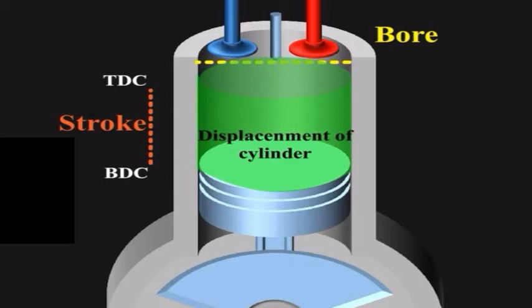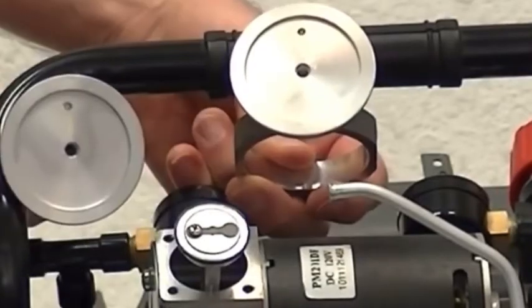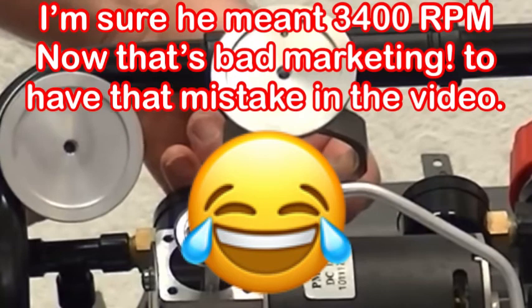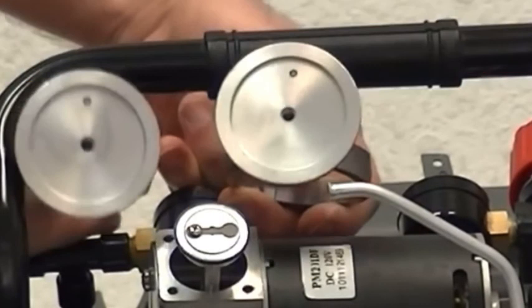The shaded green area represents the displacement — basically the volume of air we're going to be able to move at a certain RPM. You have to read between the lines to understand what they're talking about when they sound technical; a lot of times it's just good marketing. In this particular example, you're looking at a compressor the size of their motor, so of course the displacement is going to be smaller — it has to run faster and create more noise, vibration, friction, and wear. There's a thing called harmonic balancing, but we'll just call this good marketing.